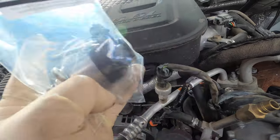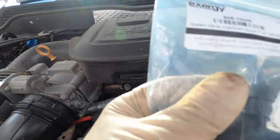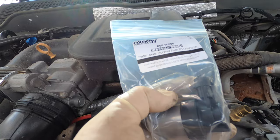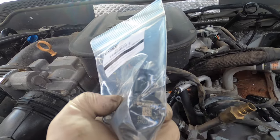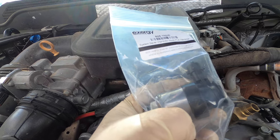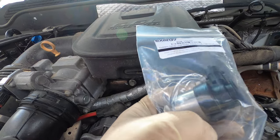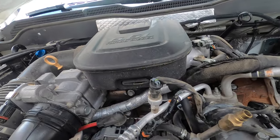So you're not changing the injectors, the rails, the lines — all that stuff. You're basically just putting in a new pump, changing the fuel filter, dropping the tank, cleaning it out or replacing the sending unit, and blowing everything out and you're good to go. I've actually had a truck that we installed one of these in and the pump blew up, and that's exactly what we had to do — put it all back together and she was great. I still see it drive by every day.